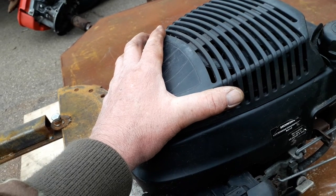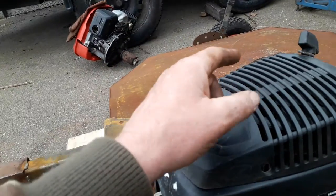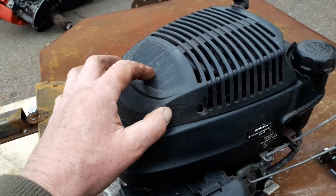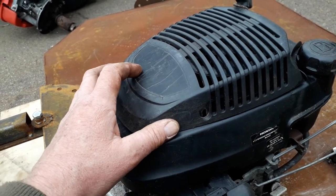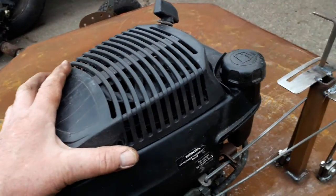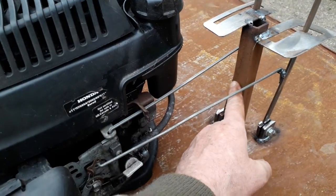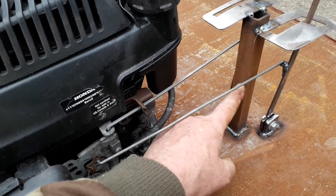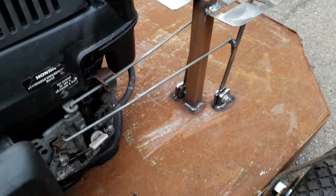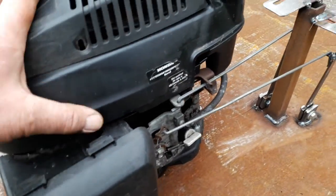For the smaller mowers - 18 inch, 19 inch - they went to a 4 horse. That 4 horse engine over there isn't man enough really, but I picked up a Hayter which had a Honda engine and that's a 6.5 horse, so that'll match this one. I'll bung that on that side, stick the other back on its mower, and rig the mechanism up behind it. I'll put a couple of supports in here - a 45 in there and a 45 there - it's just vibration that wrecks these things.